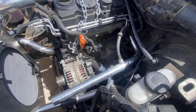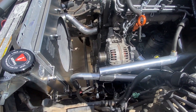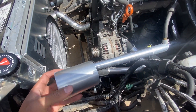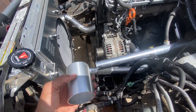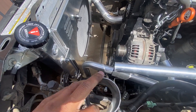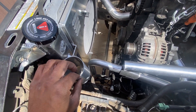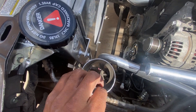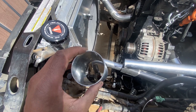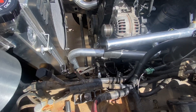We just finished up with the last little bit of the coolant system — I went ahead and cut that down. Now we're going to move on to the power steering reservoir. I'm going to make one out of aluminum — this is a three-inch pipe, and I was looking in here trying to find a good spot to put it, and this is kind of the best spot I found; it's kind of out of the way. So I'll just cut a little piece about four inches, make a bracket so it attaches right here, then make a top and a bottom, and get some bungs welded on so we can connect it to the power steering down there. Let's get started on it.